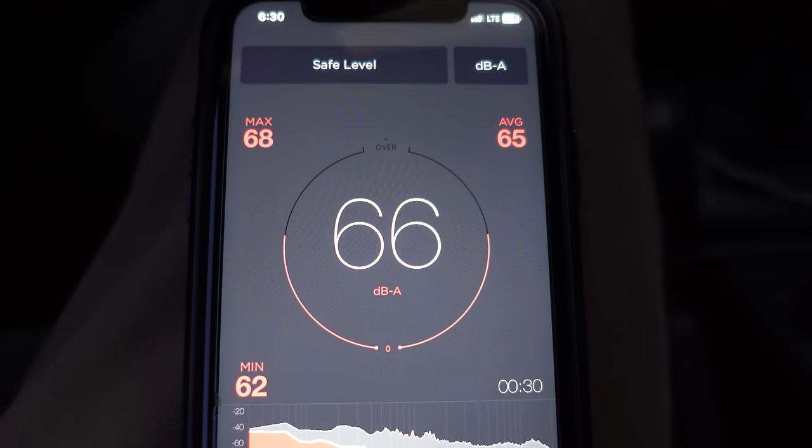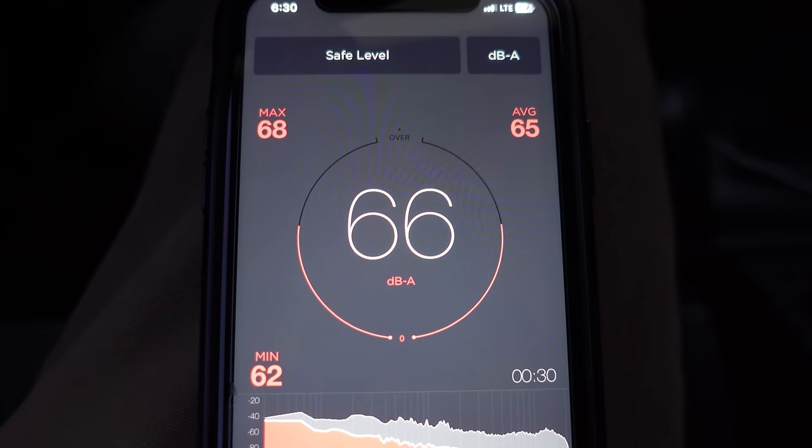Well, as you guys saw, there was about a 6-7 decibel reduction right there after installing all the sound deadening mat throughout the truck. Now, also, one of the things we have to consider is there's no interior back there. So if I were to toss in the seats and everything else, we're probably gonna get a little bit more sound reduction. And just from driving this thing around, I can definitely tell that it's quieter than it was, especially a lot of that metal tingy sound is gone from the doors and the quarter panels that I would hear pretty often when driving this.